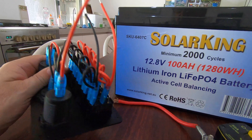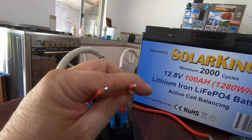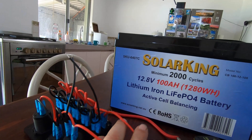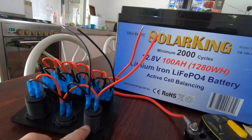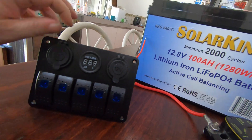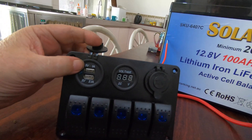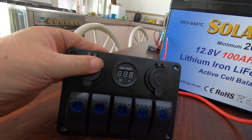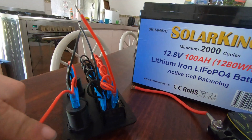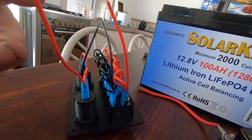Why am I saying the wiring's rubbish? It's got two red wires and two black wires. The red wires go to a socket, which is usually a 20 amp, and it goes to a usually six amp — or this one's a 3.1 amp USB outlet — and a voltage gauge on one wire. That's not too bad. You could put a 20 amp fuse on that and you're okay.